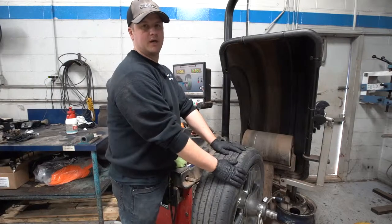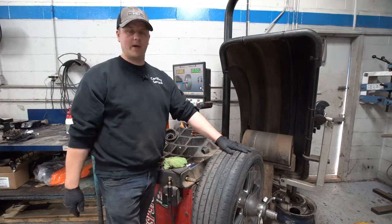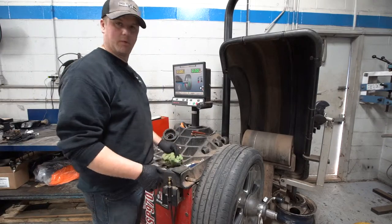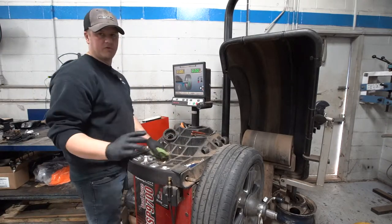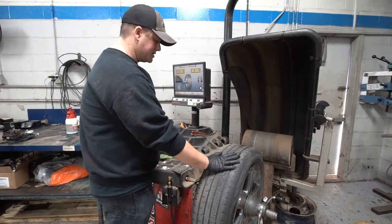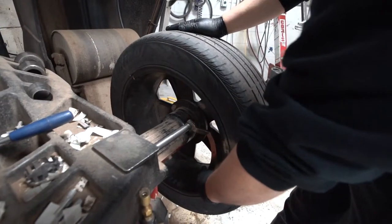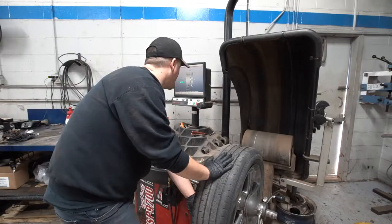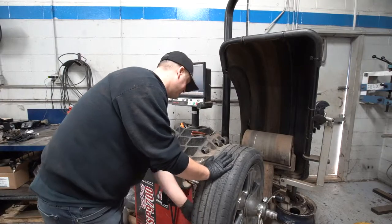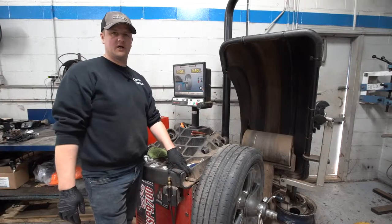There's no way to tell where the high or low spot is in the wheel or tire without putting it on a balancer. Once it's on the balancer and we spin it up the first time, we can then correct it. I've already got a tire mounted here — tires been installed on the rim — now it's time to balance it. I'm going to flip these arms down and measure the rim, which tells the machine where we're putting the weights. We can either hammer on weights onto the lip of the rim on the inside and outside.